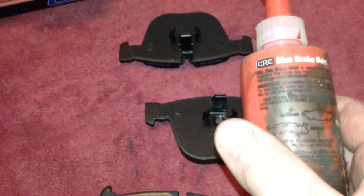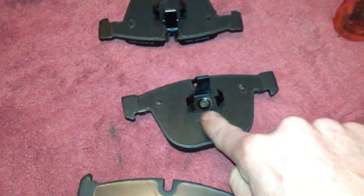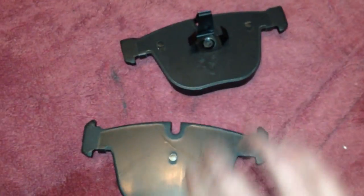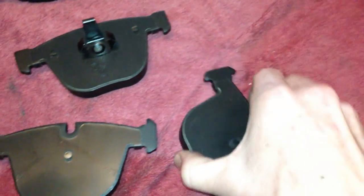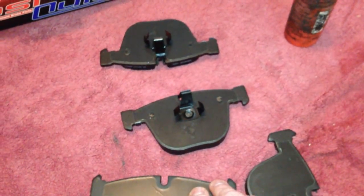We're going to put a gel coating on for quiet braking. This is CRC — same brand as the brake pad cleaner, link in the description. Pop the cap and put it all over the back of the pad — not the friction surface, the metal back side, all the way around the edges. Anything metal on metal that touches the piston, go ahead and rub it all over there. Apply to all four pads on the back side. Read the directions — you'll probably have to let it dry a little bit. It turns into a silicone coating that prevents metal-on-metal squeaking.